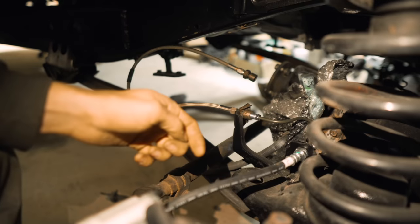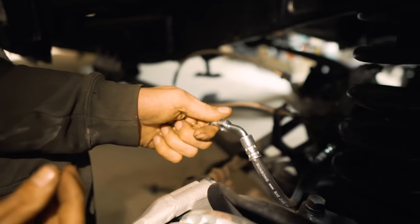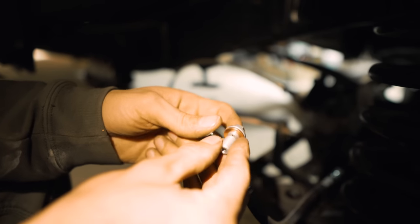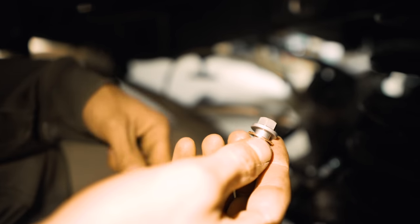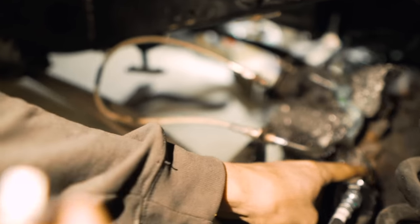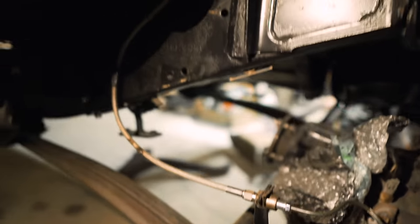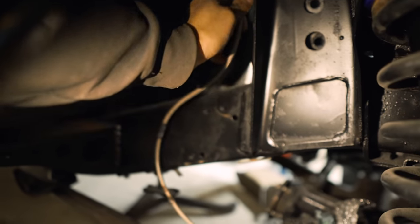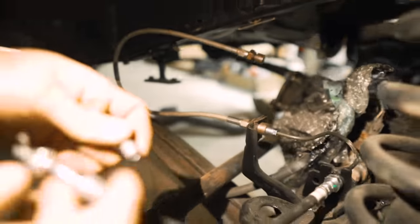Along with our brand new brakes, we are doing 100% brand new brake lines. The 80 series uses a banjo bolt at the caliper. I bought brand new banjo bolts, which were 10 bucks a piece. But I wasn't about to put a rusty bolt on our brand new caliper. So we got brand new brake lines. We're running it to a little question mark I bent here on the hard line. But we're going to run stainless braided extended lines, because we're big flexi guys. Then this will get mounted somewhere here and go over to the master cylinder.